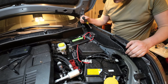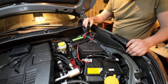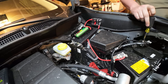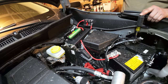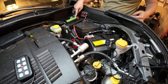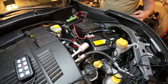Here you can see it all set up. Power goes from the positive terminal underneath the bracket to the far side of the fuse, which comes out the bottom to the input of the power panel. The last thing is connecting the negative power cable, which goes from here up through and into the negative input. At this point it has positive and negative, but you have to wake it up — usually with switched auxiliary power or ignition power, a power source that only comes on when the car is on.